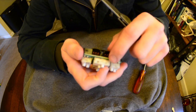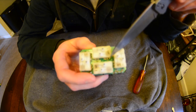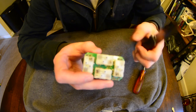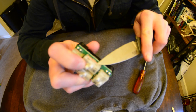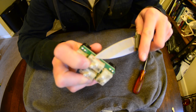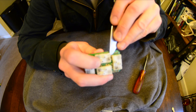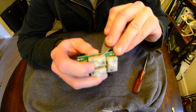Don't put too much pressure — in this motherboard here this is soldered in. In the center there are three or four soldering points that you don't want to break off. You just want to take this top cap off. Be very careful and gentle with this, otherwise you'll break that solder and you'll have to buy yourself a new switch. Very gently, just pry up on these little tabs.